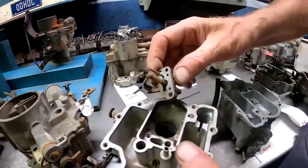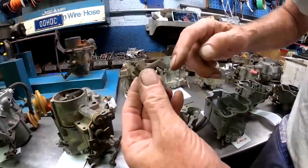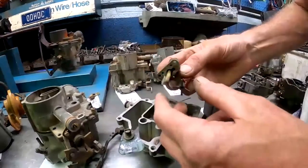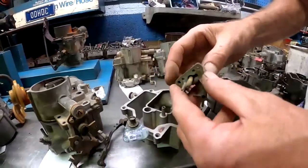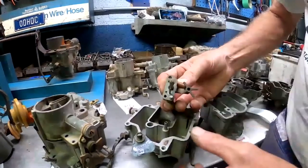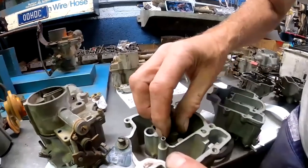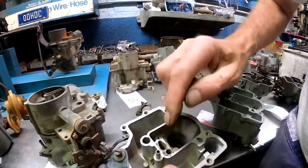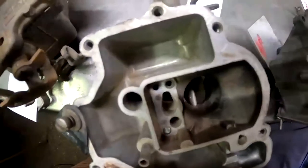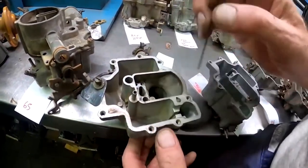And what it does is when there's a large volume of air flowing past the Venturi cluster, it's causing a low pressure area in this hole because it's connected by slotting over the Venturi cluster, so that low pressure area is causing the needle inside to rise off of its seat. And now it's pulling fuel directly from the carburetor bowl. How does it do that?